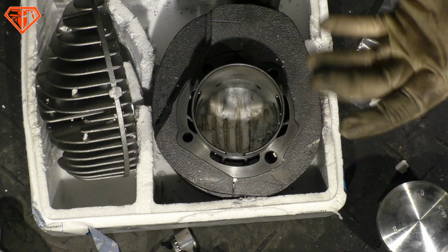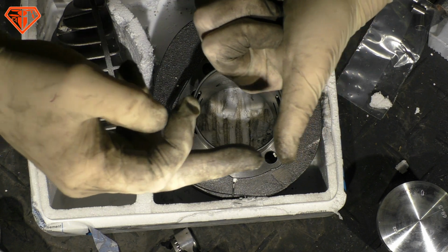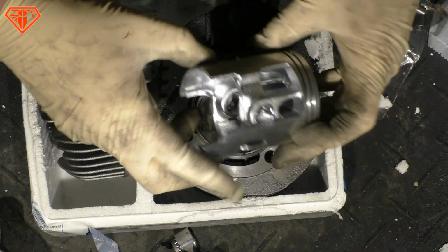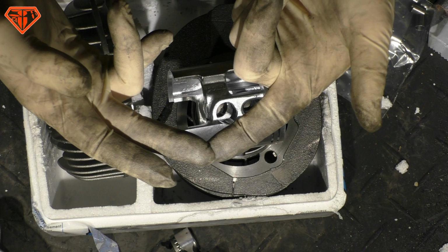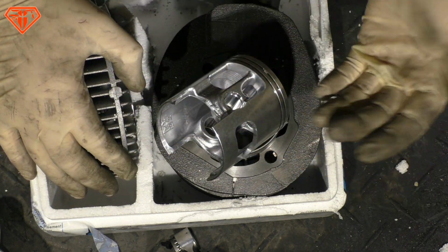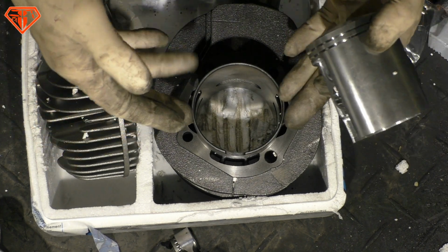What is my recommendation for the best plug-and-play setup currently in 2023? It is the POLINI box and the cast iron POLINI 210 mk2 with that new good meteor piston, and of course a fast flow tap, and open the main jet bore in the carburetor to 2.5mm, and that's it. You don't need more, because you raise the engine power you have, which is 9 horsepower with the original exhaust. With a POLINI box it's going to be 11. You raise it to 15-16 horsepower with just exchanging the cylinder.